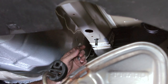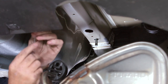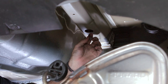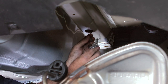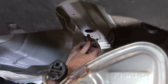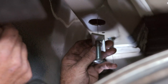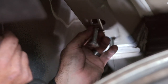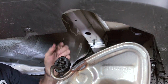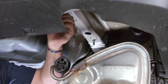Now we're going to go ahead and do the most rearmost bolt. I'm going to put the bolt buddy head through the hole, just catching it as it comes through the access hole. I'm going to thread the carriage bolt — the one with the small plate — onto our bolt buddy, put the spacer plate up ahead of the bolt, and again leave the bolt buddy attached so we don't lose our hardware inside the frame. These steps will be repeated on the driver's side exactly as shown.